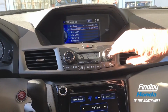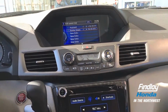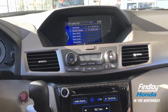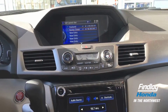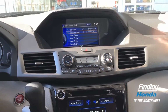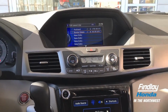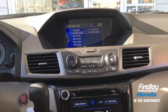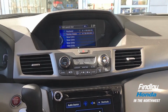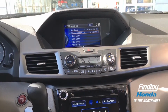This system here would be the closed cabin system or recirculation. So when this is lit up, you've now closed the cabin and you're recirculating, cooling, heating the air in the car. When you have this off, you're taking air from outside the windshield in through this big air box we described. It's being cooled, cleaned, and heated, whichever, and spread out through the car. When you close it up like this, now you've closed down the system, and it's going to re-cool, re-clean, and push the air in and out of the vent system without taking exterior hot air or cold air in.